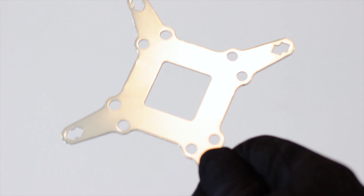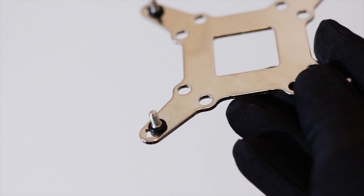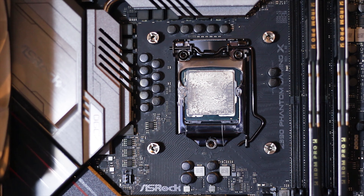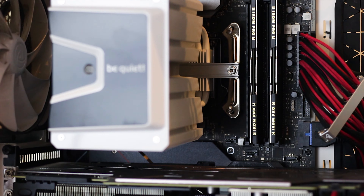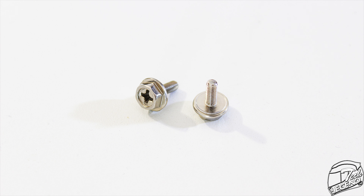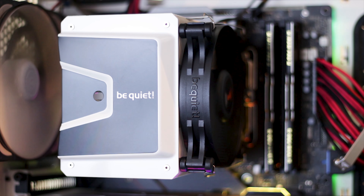The installation process for this cooler is pretty simple. We start with the backplate, then attach the required studs into the correct holes of the backplate itself. You then attach the rubber washers over the studs to hold them in place. The backplate goes at the back of the motherboard, and at the front near the CPU socket you attach the required washers, nuts, and adapters, then attach the mounting arms over them, securing those with the smaller Phillips screws. Finally, you place the thermal compound on the CPU, place the heatsink over it, secure the heatsink by attaching the main mounting beam over the base plate, and tighten the two bigger screws. Then install the fan on the correct side of the heatsink and connect it to an open fan header on your motherboard.